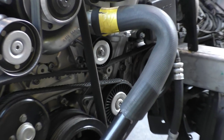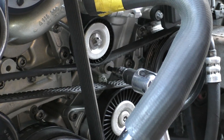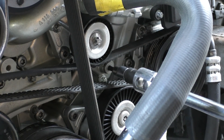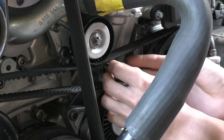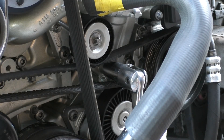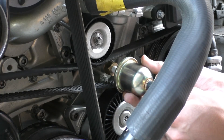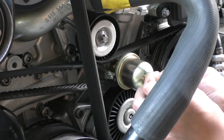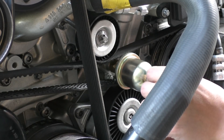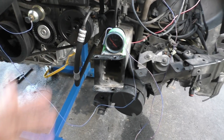For the next day I started off by connecting an oil pressure gauge so I could also have a look at my oil pressures. I also used an OBD2 scanner to make sure all the values coming from all the other sensors on this engine were normal. Connecting an oil pressure gauge on this engine is super easy because there's already a place given for it — you just remove the plug that's there, which is M12 by 1.5. Most aftermarket gauges come in 1/8 NPT so you might need an adapter. I just put that adapter there and put the sensor at the back, and I've taped the gauge over here for now.